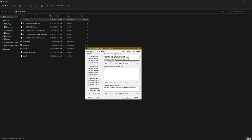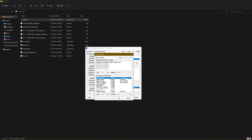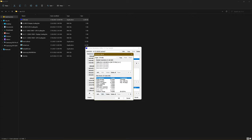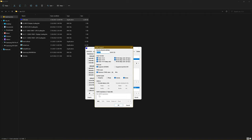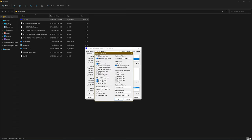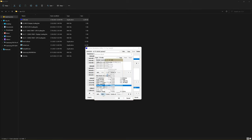This last line — do not delete it, leave it. Everything here should have all these checkboxes unchecked. Click the extension block, go to edit, and there's another custom resolution I added at 60Hz. You want to make sure that's all you have left. Under HDMI support, you'll have some resolutions you need to delete and get rid of. HDMI 2.1 support can remain the same — there's nothing you really have to mess with there. Video capability and color information can stay the same.